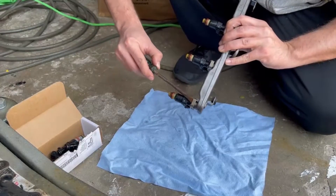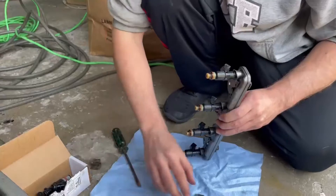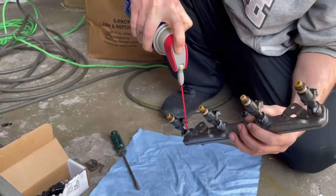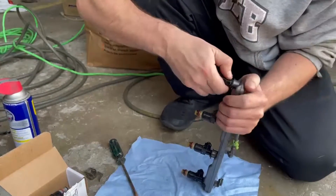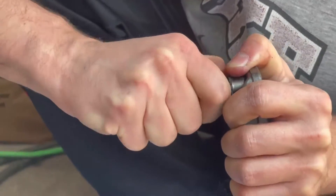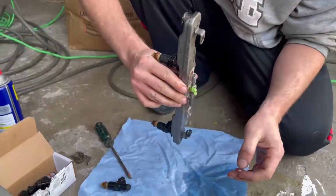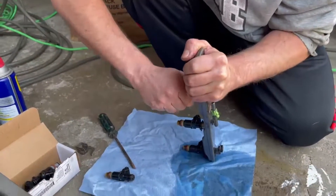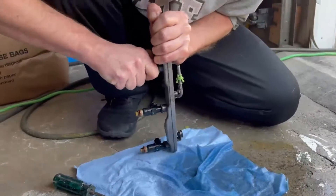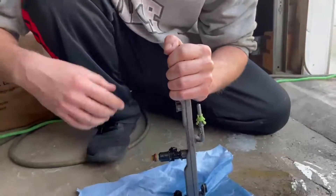There are these metal clips you just have to pry off from the injectors that hold them in place. One trick I did — I took WD-40 and sprayed it right in these little pockets here just to lubricate the gasket a little bit. These things will be pretty stuck on there, so I let them soak overnight. Now just wiggle them out and pull back — this is going to take a lot of effort. Just keep wiggling, keep pulling, and they pop. You can see that 93 octane coming out. Just pull them out.